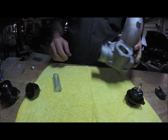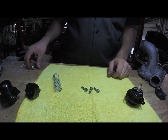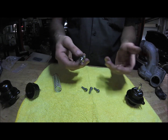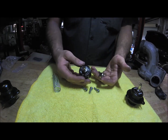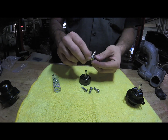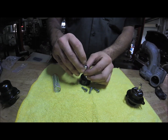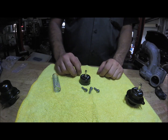When you buy these new from Turbosmart they come with new bolts and also a 90-degree swivel fitting. I personally prefer to leave the straight nipples on — it's a lot easier — but if space is tight you can use the swivel fitting. Just remove the original one and spin the swivel on by hand. Don't use a spanner — you can over-tighten it and squish the O-ring out causing a leak. Spin it all the way around until it stops, then just turn it a little bit further to seat it. That's your blow-off valve CBV operation.